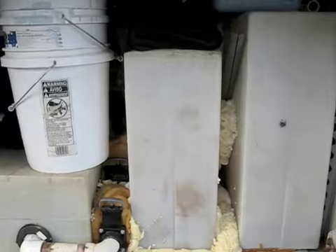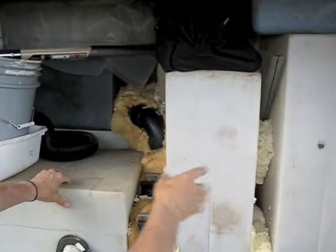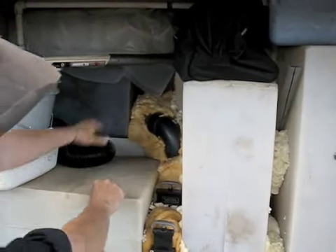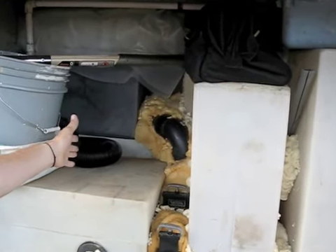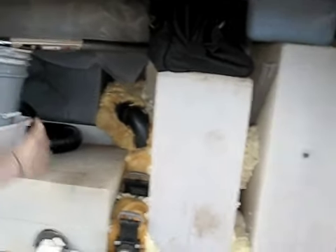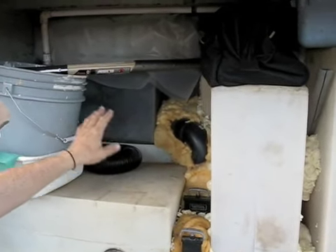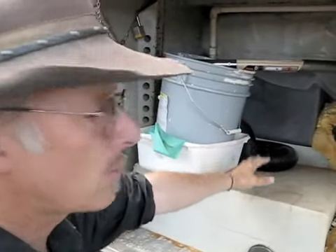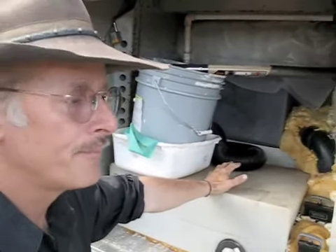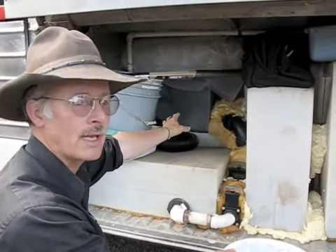If you get a leaker, you've got to clean them. In here that's almost 200 to 250 gallons — you can't have too much. We have a black water tank right here, our sewer, and grey water. I wouldn't stack them like this. I would make them vertical so they can also be cleaned out. We have about 50 gallons of sewer, and I would go with about 100 gallons, because when that sewer is full, it's full and you can't do nothing about it.